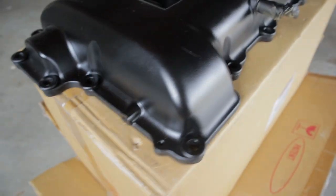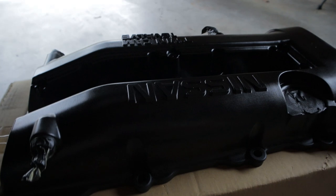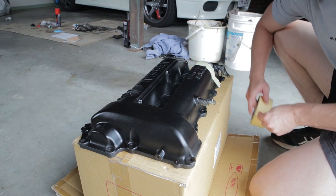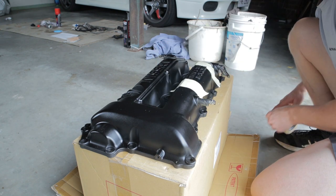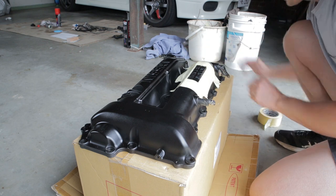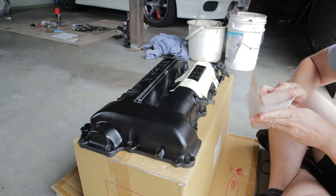It's been a few days because I've been slack, but the paint has fully dried now. So here it is — I don't think it's perfect by any means. What we've got to do now is shave off the black that's on the Nissan letters here and get them back to chrome. I'm just going to tape anywhere that I think I may accidentally scuff with the sanding block, either side of the letters, to give it some protection. I'm going to use a sanding block and some 80 grit sandpaper and try to be very careful.